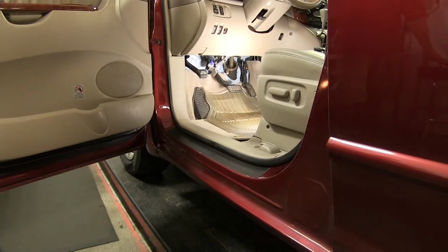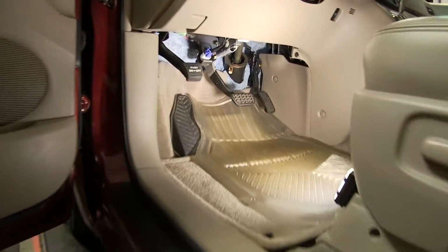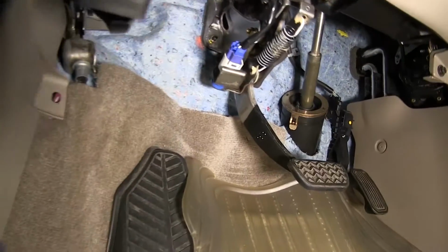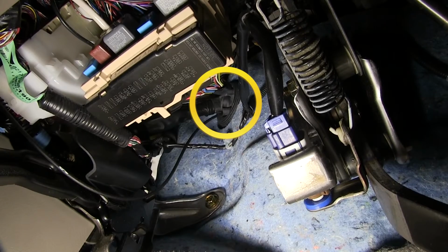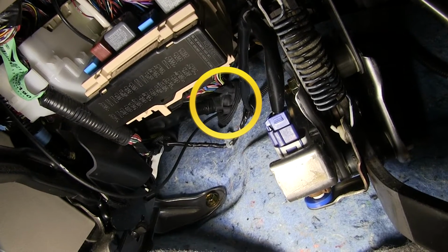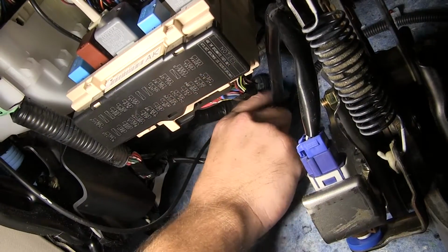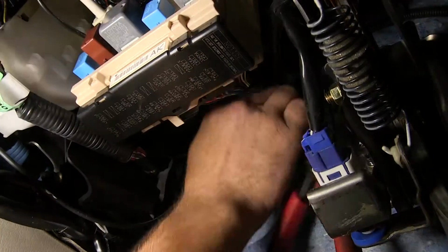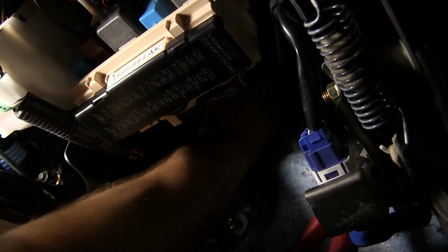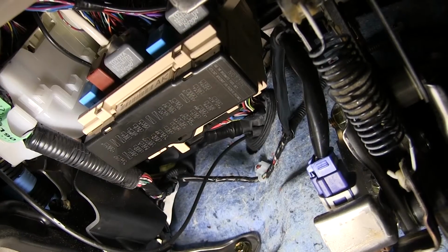Now with our wire routed to the top of the engine compartment, we'll need to locate an area that we can route through the firewall. For this application, we're going to utilize the manufacturer's grommet here on the driver's side behind the dashboard. Using a utility knife, we'll cut a small hole in the grommet and then use a fish wire, which can be a stiff piece of metal, or in this case, a piece of air tubing, to route through the firewall